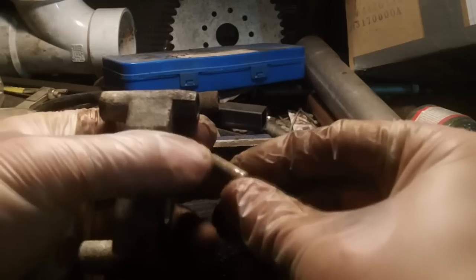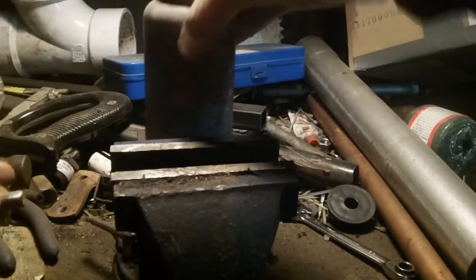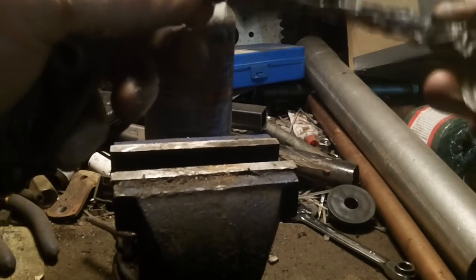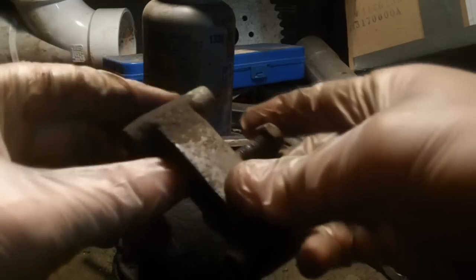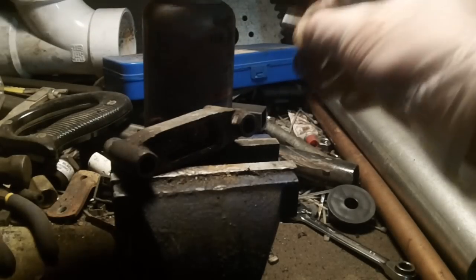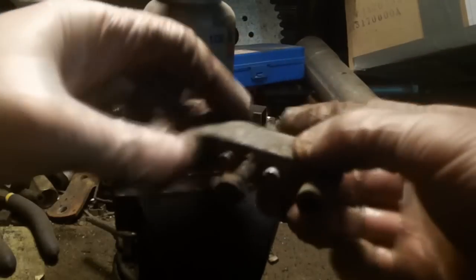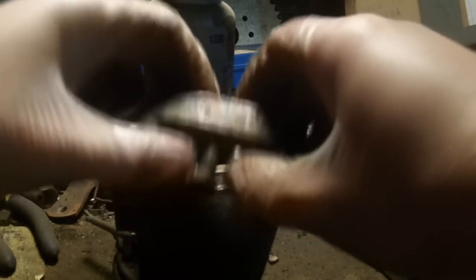Alright, at this point we've gone over these with some 600 grit and taken all the big areas off, and we've got our anti-seize. We're just going to take and do the tip, and push it back through — just like that. Take the tip and push the other one back through as well. From here you should be able to go back and forth nice and easy. As you can see, they both free-float through there.